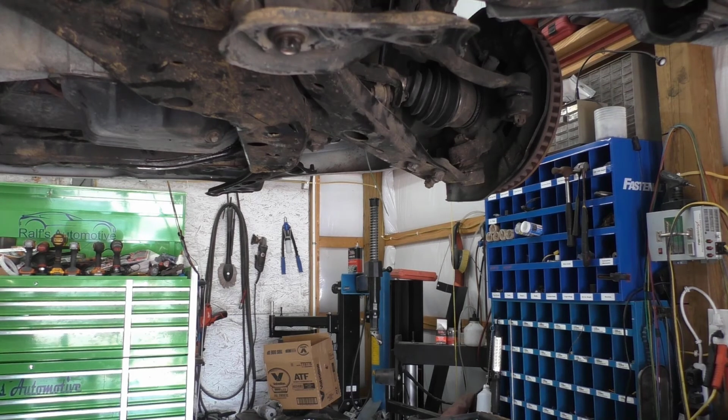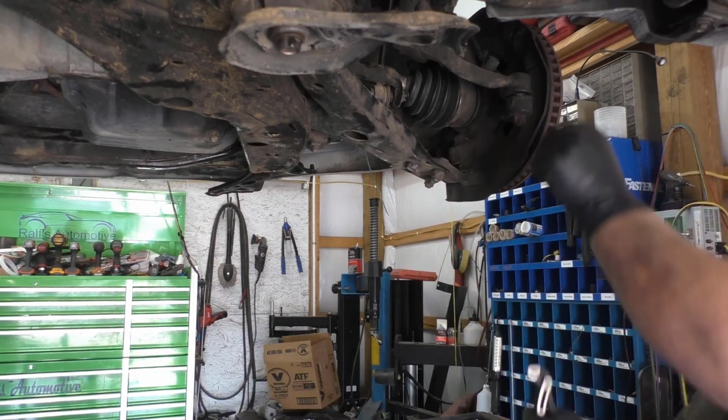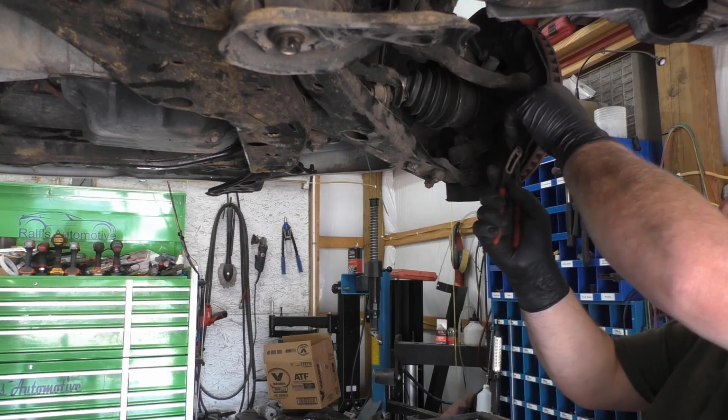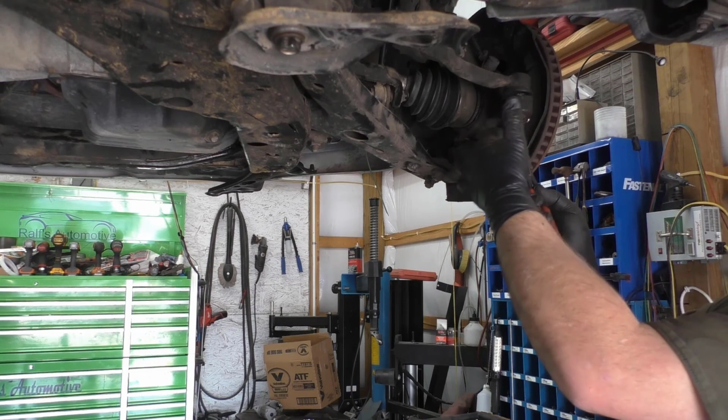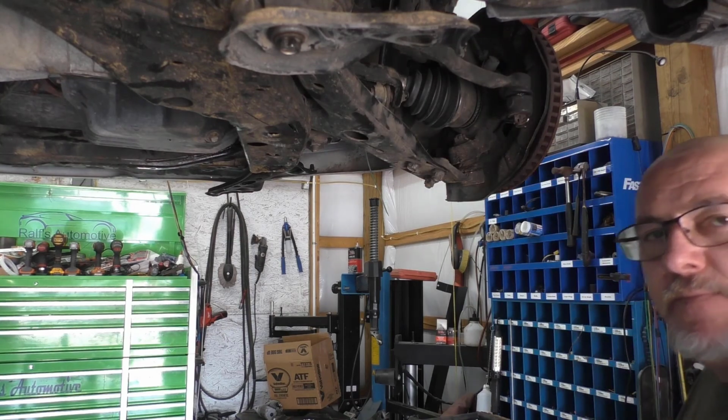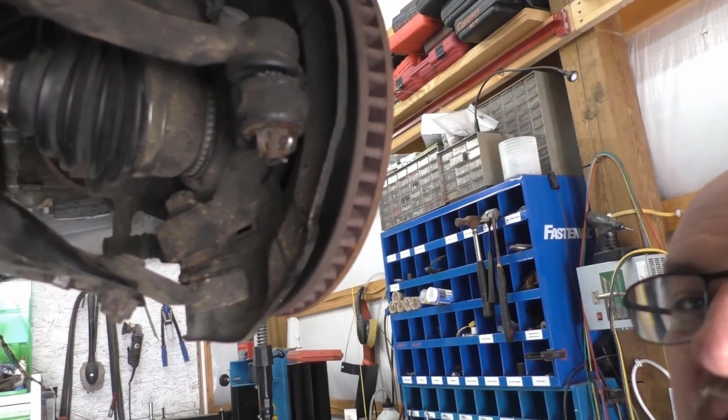See if I find some cotter keys that fit it. Yeah, put them cotter keys in, leave a little tail for the next guy. He'll appreciate you. What I mean by that, don't mangle them over. Push the one end up slightly. You can't go nowhere with the other end. Fold it on the bottom. Fold it on the bottom like so. Good enough. Not going anywhere.